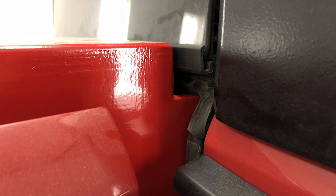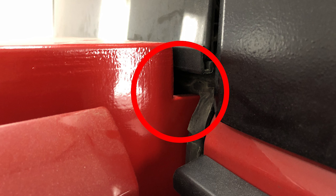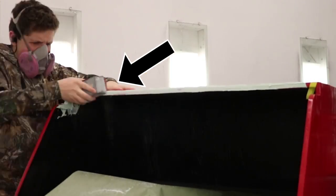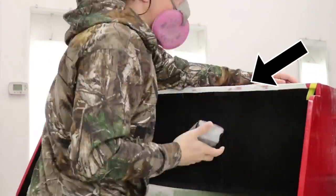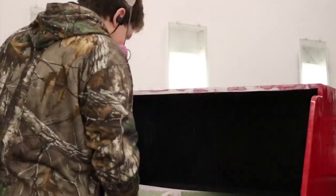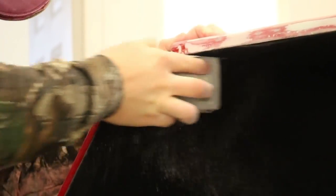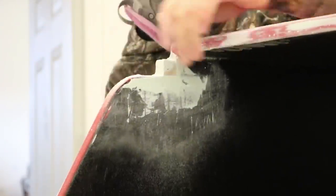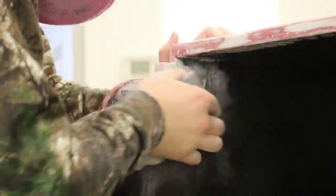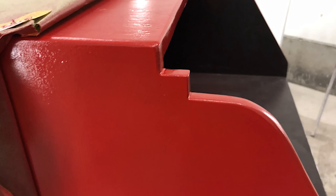There was a little gap where the jamper meets the jeep and it had a hole. So I filled it with a little block and then put bondo all in it to fill the gap. I also bondoed the entire face that you see me sanding here because I needed it to be really flat for the weather stripping I was going to put on it to seal the space between the jeep and the jamper. I'm sanding that block out with my square block so it could look professional and factory. Fit right in there and then I painted it up and blended it nice.